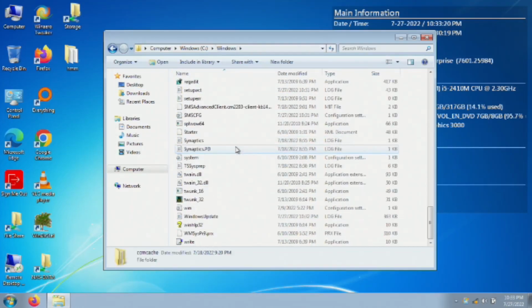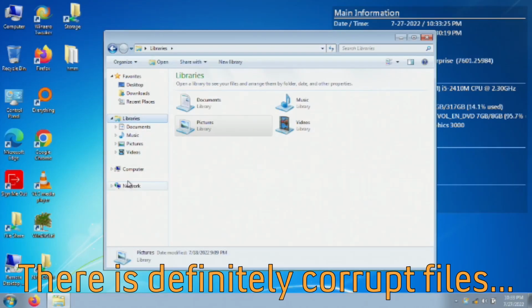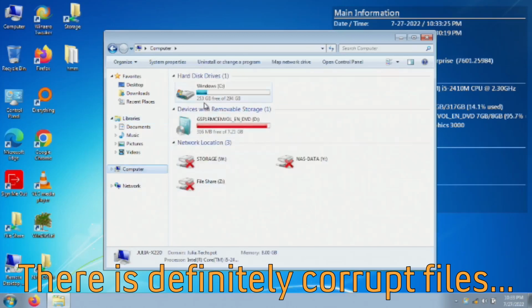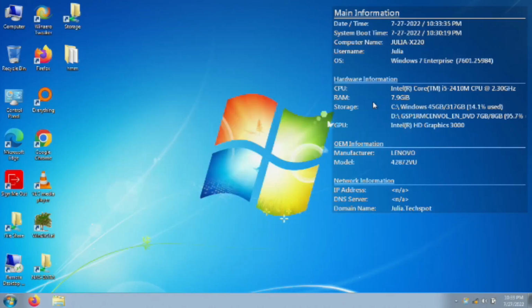But yeah, this Windows installation is definitely not going to be perfect. Yeah, it'll work, but you might run into issues in the future. But I guess we did partially fix it, so that's pretty cool, actually. I didn't expect to recover from this virus at all, but all it apparently took is a startup repair and then those bootrec commands, and it seems to have fixed it.